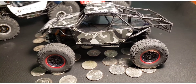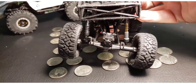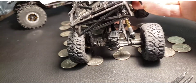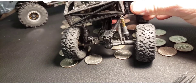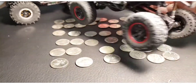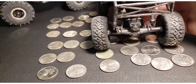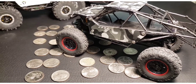Articulation is good up to a point — beyond that it actually hurts you. The only reason I run the double barrel on the left rear is because it doesn't affect climb performance. During a climb you get torque twist and torque rise, and it all happens towards the right side, so the left rear isn't flexing up during a climb. It will pop on steep descents, but it's still better overall with that single kinetic shock on the back. I also have a single flex blade on the left side, which works fantastic — it's just that extra little bit needed when the frame is hitting something going over a peak.